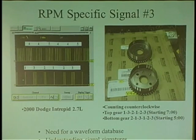The guy's cranking the engine, I know the crank sensor's working. I take the cam sensor signal, the 5-volt line, and I keep grounding it real fast, and boom, it'll start up and run, because I hit it just right. You can do that. That's what computers do. They play Russian roulette.